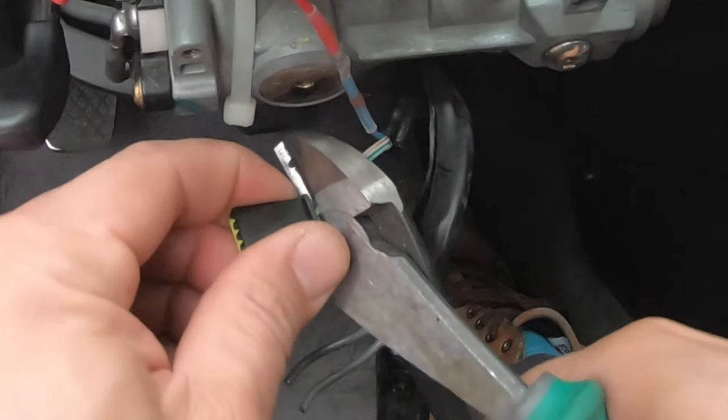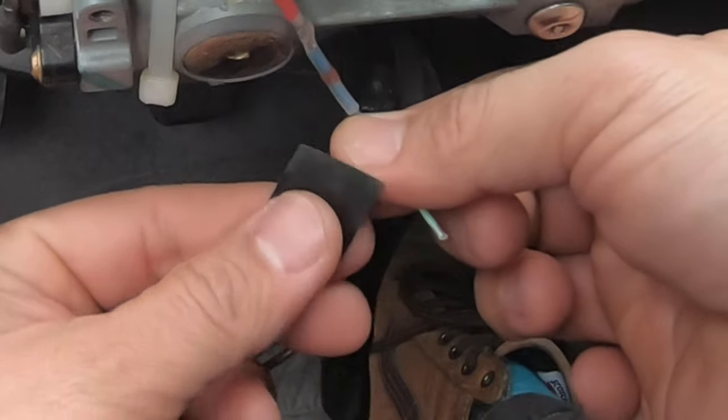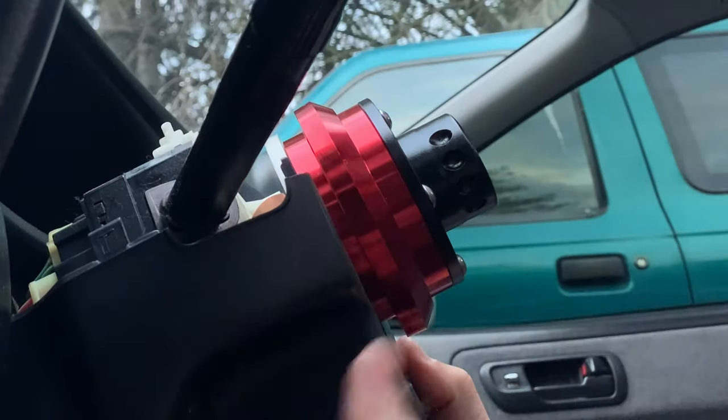To clean up the wiring, you can cut off the connector and tape off the cruise control wires. After this part, I spent about an hour or two trying to get the airbag light to go away. Normally all you need to do is use a resistor in between the two airbag wires, but for some reason this wasn't working. After about two hours I found out that Hondas and Acuras actually have one extra step you need to do in order to make the SRS light go away completely, so I'm going to do a separate video just for that purpose. The good news is that up to this point the car is drivable and the horn works — so if you don't care about the SRS light you can just put the trim pieces back on the steering column and call it a day. It was dark, I was cold, I was annoyed, and I was over it — so that's what I did. But I don't like that blinking light, so I did come back the next day and got that fixed. Stay tuned for that video, it will be coming up soon.